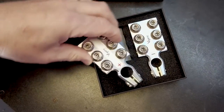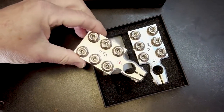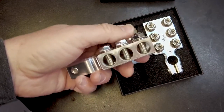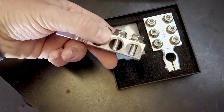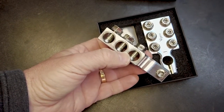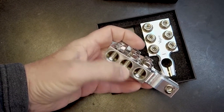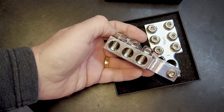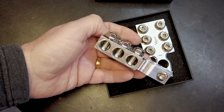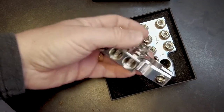I opted to keep it simple and use lugs over the top studs, which accommodate large diameter wires too. I have some concerns with the side holes — they reportedly take up to a 2-aught wire, but I'm not a fan of putting a wire in there and having a fairly small stud come down to capture it. I think it's much cleaner to connect on top. If I were going to use the sides, I'd probably crimp a ferrule around the wire first before tightening the stud down.